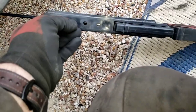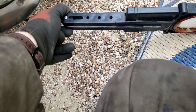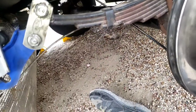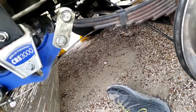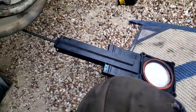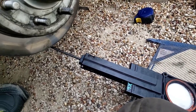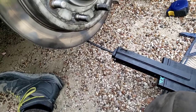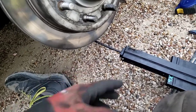I'll make sure that the holes are facing toward the ground and not up where they're not accessible. The main thing is as you route this, make sure you allow for plenty of play. You need at least — from what it's saying — 12, 14, 16 inches. The bigger the loop the better, because what happens is it binds up and becomes really unworkable. So don't let your OCD get in the way. This is designed to have a big loop in it. It's not a bicycle cable — because you're pushing and pulling, braided line doesn't work. That's why it's a solid line.